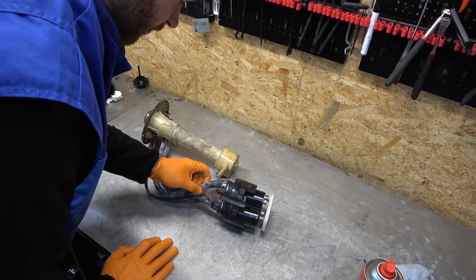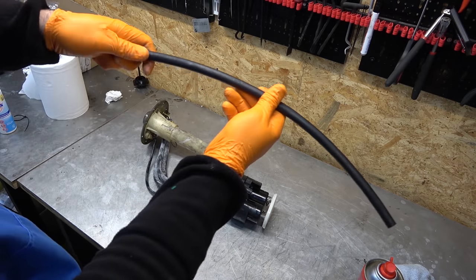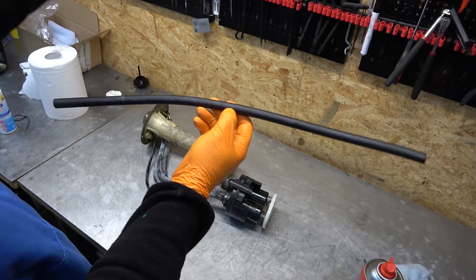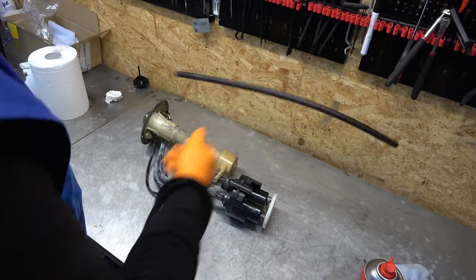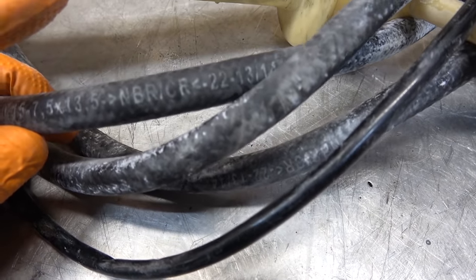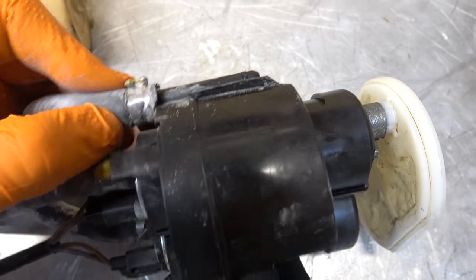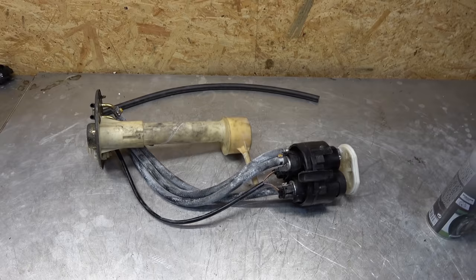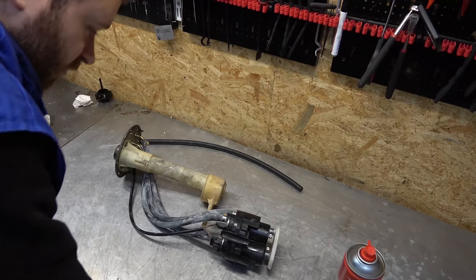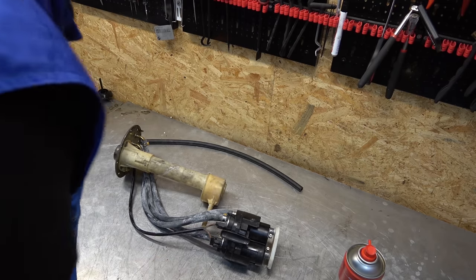The fuel pump is out, and it's pretty obvious the previous mechanic was in here. These are not the original fuel pumps — they're Bosch, the connector type, and these are actually good quality. If these two are working, I'm not going to replace them. Where the previous mechanic failed miserably is with these fuel lines — he used regular fuel lines inside the fuel tank, which is a big no. In Germany, NBR/NBR means submersible fuel line; NBR/CR means outside use only. You can see how this hose is swollen and starting to crack. Luckily the previous owner didn't drive this much, because if the fuel tank was full, all of this would melt within a few days and the car wouldn't run.